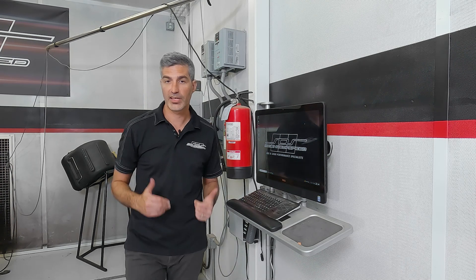The testing we do in our dyno test chamber uses our all-wheel drive Superflow chassis dynamometer. This dyno is incredibly precise when used properly. We monitor ambient temperature, cooling temperature, and the engine's inlet temperature to ensure reliable results. We've found that if we hold these testing parameters consistent, we can do back-to-back tests with only about a 1% deviation. For this type of test, we used the taller 4th gear to slow everything down and make subtle changes more visible. We've used the 1995 3L NSX and now today a 2002 3.2L NSX, specifically because we can monitor those engine parameters over OBD.